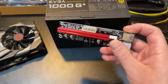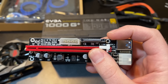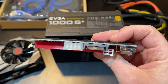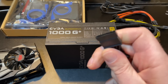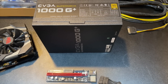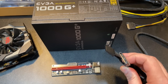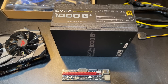Let's get this one out of the way. This connector may look familiar to you — that's called SATA. It's typically used for hard drives, and a lot of the newer risers don't have it, but the ones I buy still do. Not that I use it — you may want to plug that right into your riser and then into your power supply and start mining. But let's talk about why that's not a good thing to do. You should avoid using this to power your riser for your GPU at all costs. Let's talk about the spec of SATA.